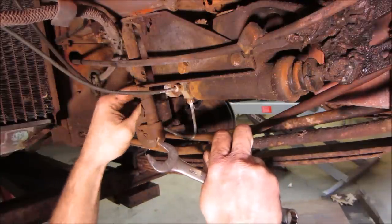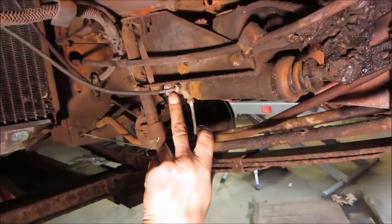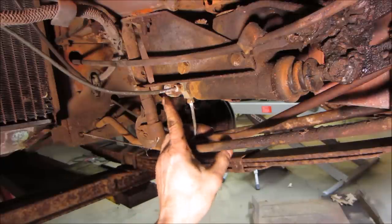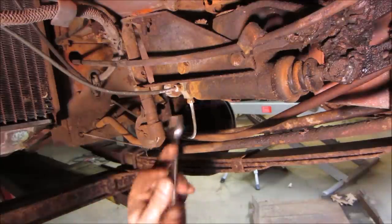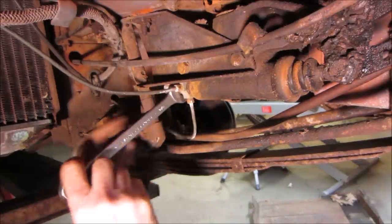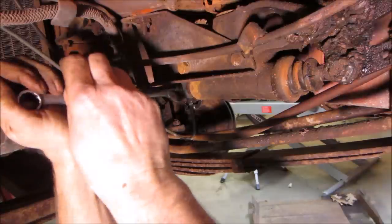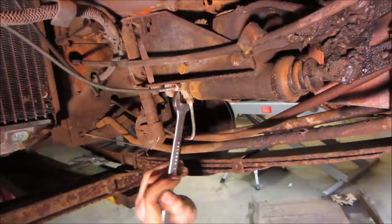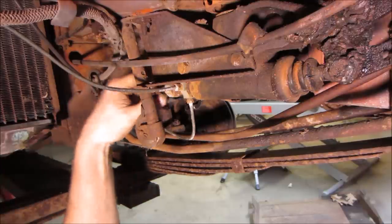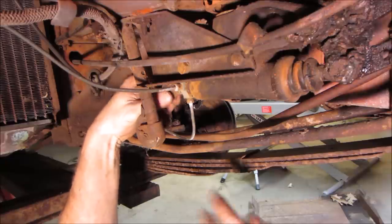Those two wires just complete a circuit. The switch, you hit the brakes, makes hydraulic pressure, pushes a set of contacts in here, makes brake lights come on. And yes, I do have a line wrench, but we'd have to take that switch off. So let's go see what we get first. It moves. Good. A firm believer in leave well enough alone if you can get away with leaving well enough alone.